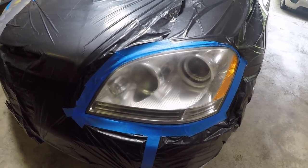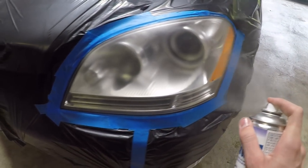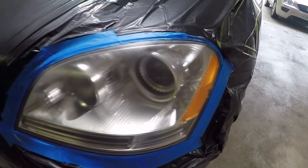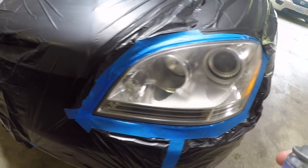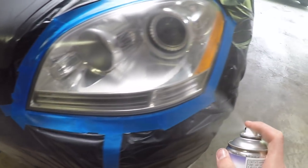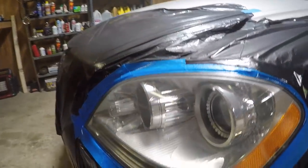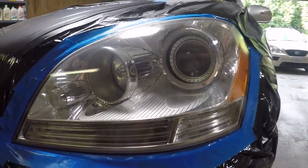It's been about two or three minutes, so now I'm going to come back and do the second coat — going a little bit thicker on this coat, but not too much yet. Starting to look a little bit better. Still see a lot of orange peel, but hopefully that'll come out in our third coat. We can also do a fourth coat if we desire. Now we're ready for our third coat — this coat is going to be a little bit thicker than the rest of them.